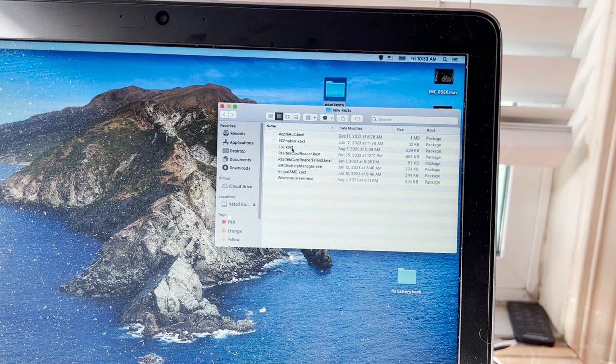Once I have that, the EFI partition will be finished, and I'm going to zip that, and I'm going to put that on one of my Google Drive accounts and set it up in its own folder so that you can go and download it without having to bother me about it. And then after you get your system going and run all the stuff in the older package that you need to do, then you could replace the EFI partition with the one I am providing you, drop that into your EFI, and you should be able to have your battery and your sound working.